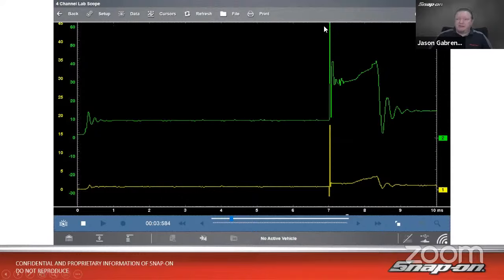So that is my secondary voltage right there, jumps right up. And then for the firing line. And then we have my spark line over here. And then we see the coil oscillations at the end. Now, this is the primary side down here that we have hooked up. And we see, once again, oscillations for dwell, goes in, firing line, spark line, oscillations at the end.